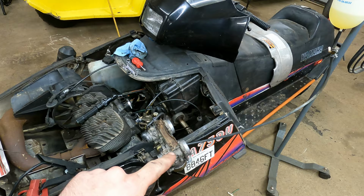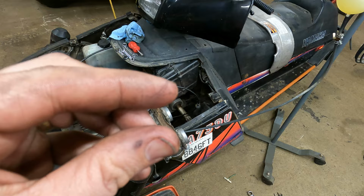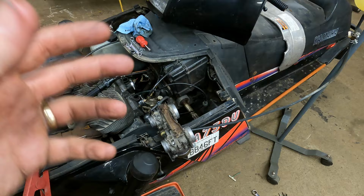The O-ring where the bowl seats up against had one spot, maybe that long, that was kind of half, I don't even know, it was goofy looking. So I took the O-ring out, I flipped it upside down, and I got it worked back in the groove, and it looks pretty even.